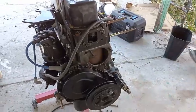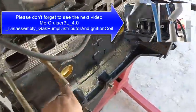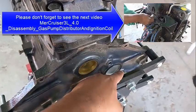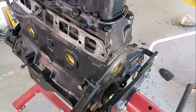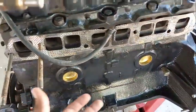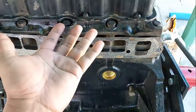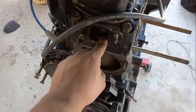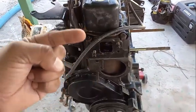The water flows inside and goes through the water jackets. These freeze plugs are so that if you forget to winterize, the engine is protected. There's another freeze plug right here, and that one is actually for the camshaft — they're that color because of the water. The water pump pushes the water in, it goes through the water jackets, then flows up through holes between the heads and the block.